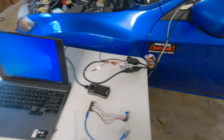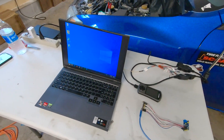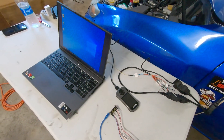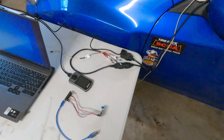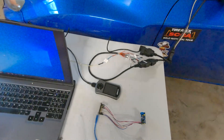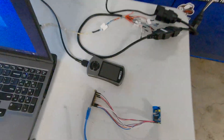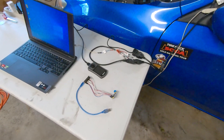In this video we're going to hook into the CAN bus system and prove we can sniff - read - raw data coming out of the ECU, log it on a computer, and read it with an Arduino. We'll also demonstrate how to read the commands the AccessPort is sending, to figure out what it's doing for its display so we can reverse engineer and mimic those protocols.